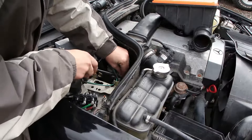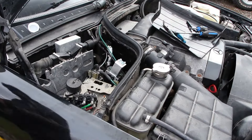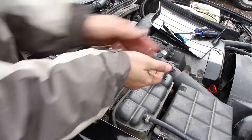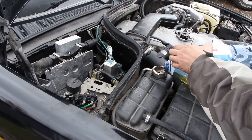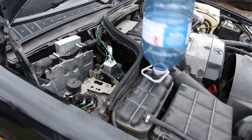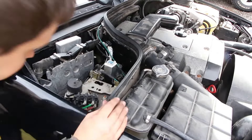Reassembly is the opposite of disassembly — just don't forget to plug everything back in and tighten the hose clamps. Put the coolant you siphoned out back into the expansion tank and start the engine. I like leaving the coolant cap loose on the first startup to help bleed any air out of the system. Check for leaks, let the engine warm up, and make sure the duo valve holds the interior cabin temperature steady. Once everything works, tighten the coolant cap down and you are ready to go. Thanks for watching.